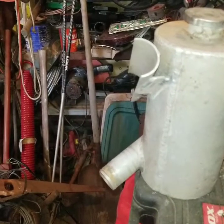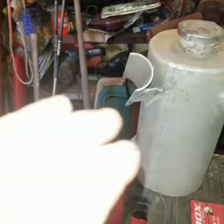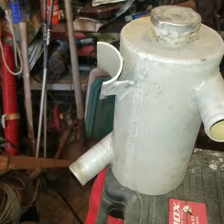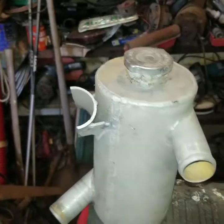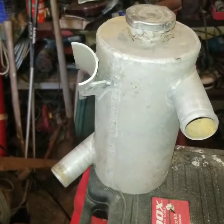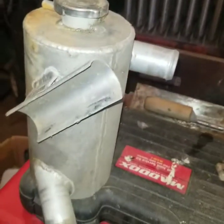If you go to the old cars, like old Chevys, where the radiator cap is on top of the radiator, essentially the top portion of the radiator is at some point in time full of vapor. Modern cars are not like that — they actually have a separate surge tank. So that's what a swirl pot is: swirl pot, swirl tank, vortex chamber.